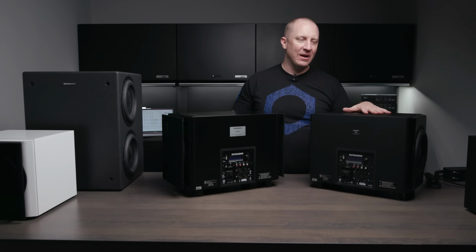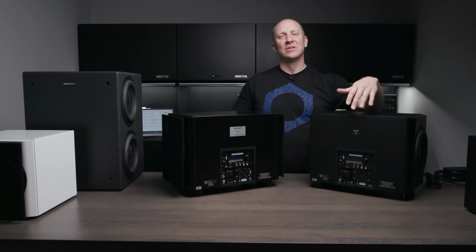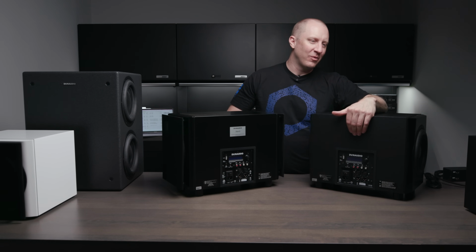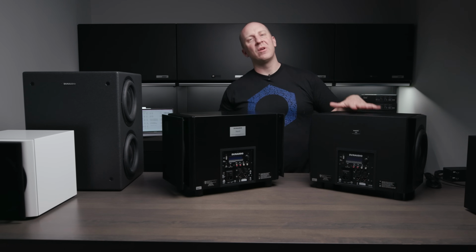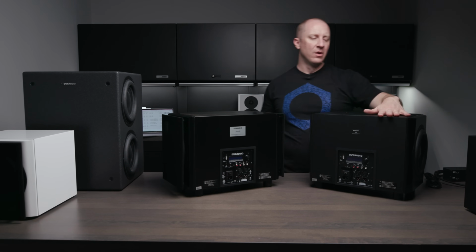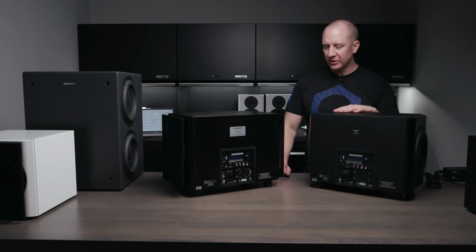Even if you do have some Dynaudio Emits or something set up in the garage, I think you're going to want to buy this and just set it to a 24 dB slope, or change it with the appropriate slope, something like that. So you choose one of the other prefab DSP settings and not choose the setting that you would use if you had one of those speakers.